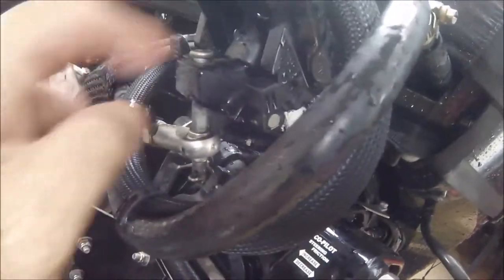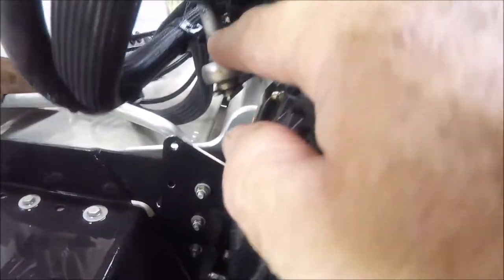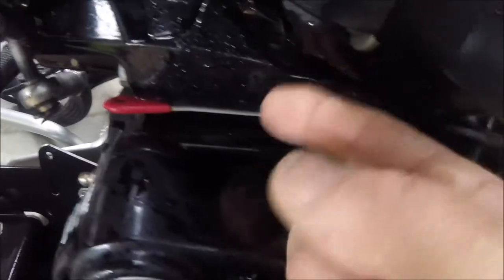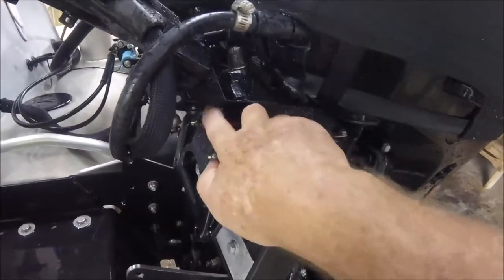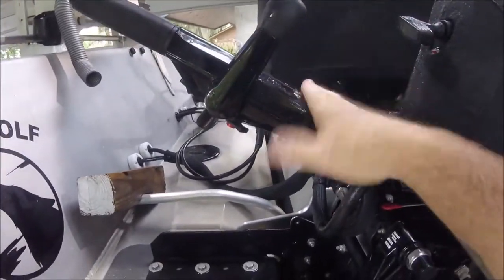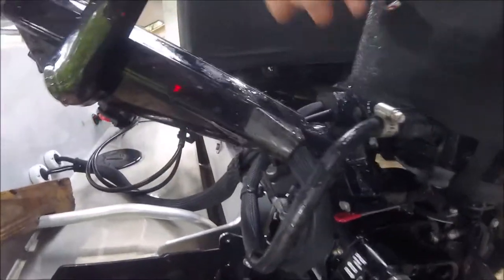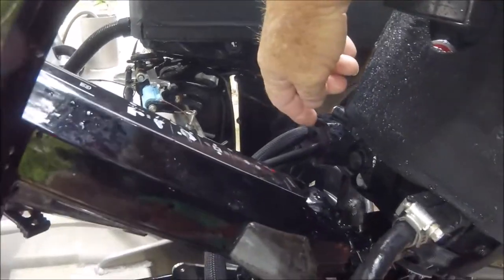Here's the rod that goes over — it's just a pin with a cotter pin, and this is adjustable in and out. You can kind of see that pin system there, so this is connected to all this. These bolts right here are going to go bye-bye and this entire contraption is going to come off, because it's got the shifter and the throttle linkage all inside here. I'm going to be left with having to bring that out and basically this rigging tube — that's where the shifter cables are probably going to go in.